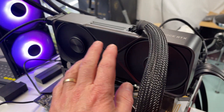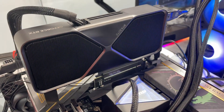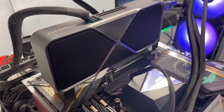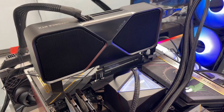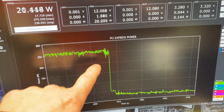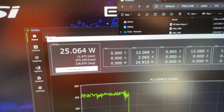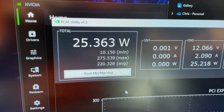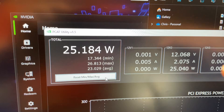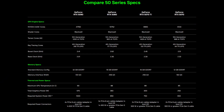Keep in mind that all the air drawn in from the bottom side of the card is being dumped back into the case, and you want to avoid that hot air being recirculated by the intake fans — you don't get good cooling efficiency that way. It's important to have a case with good air circulation and exhaust fans to draw in cooler ambient air. As soon as we killed the game, we went back down to idle — around 15 to 25 watts. We peaked around 275 watts, but that was probably a quick blip. At idle the card is 20 to 25 watts.